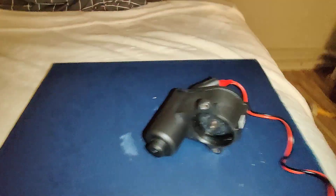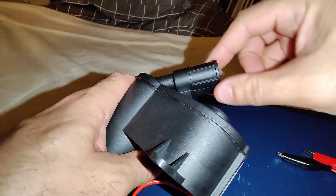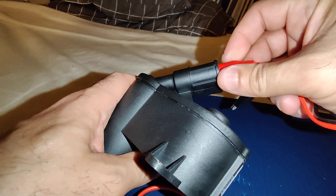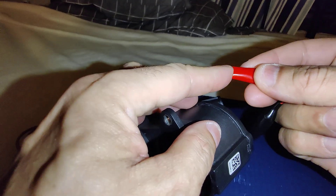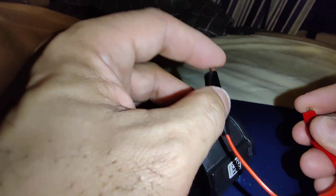But make sure guys — disconnect your negative battery cable from the battery before you start messing around. When you do this, disconnect the battery cable and unplug the plug that goes here. This is in case you don't have a scan tool. Then plug this one here, one here — make sure they don't touch, and make sure this rubber piece is covering the whole connector. Then you connect it — just make sure these two don't touch, because you can mess up the motor.